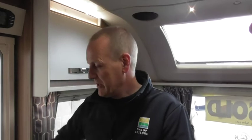Right. Okay, so a mixture of gas and electric. What it will do from cold is use both energies. Once it gets to temperature, it'll shut the gas off. It's prioritised to electric, so it'll tick over on electric then. If someone leaves the door wide open like I have, the temperature drops, and gas will kick in alongside electric, so it's not using the gas all the time. It's using electric and gas then to get up to temperature. Then again, it will shut the gas off. Right. Okay. So that's either 1 or 2 kilowatts.